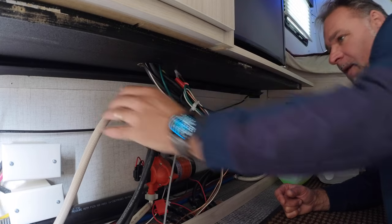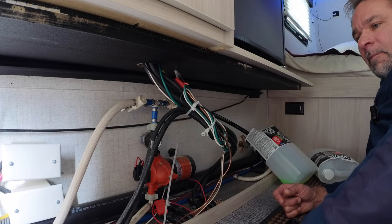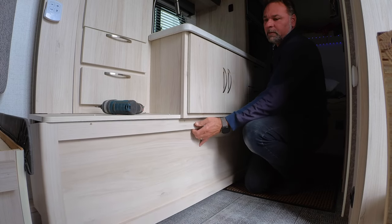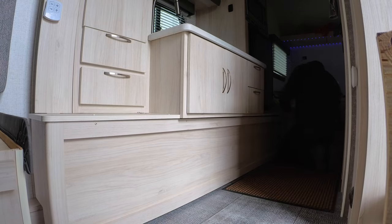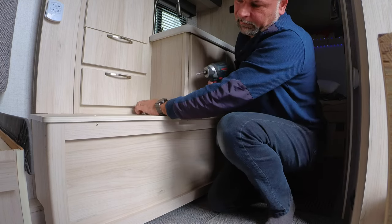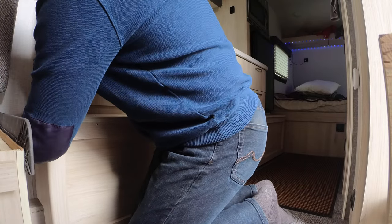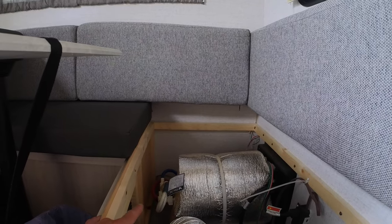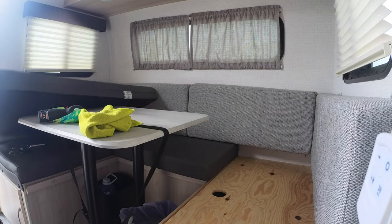Now I'll clean that up so it won't leave any funny colors over the winter — I'll scoop it into the drain and wipe everything down. Now we can close everything up. At this point I can remove the suction hose from the bypass at the pump — this way when I come back next year I don't have to open the cover again because the antifreeze is already in the system. Stow the stuff nicely out of the way, put the cover back on, and start with this screw first. Be careful not to over-tighten anything as that will wear out the threads in the wood very quickly. Leave the hot water tank bypass closed until you start filling fresh water next season.